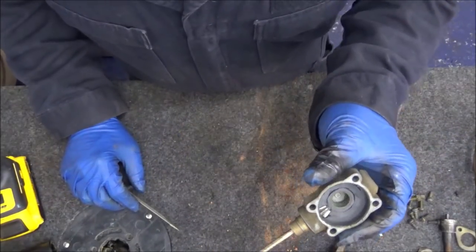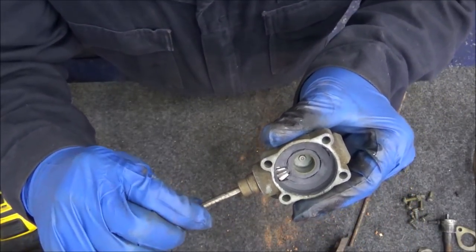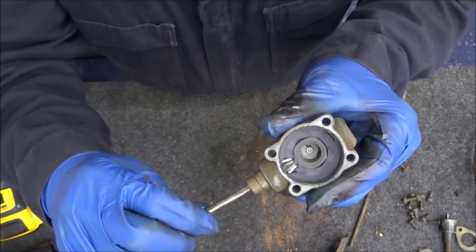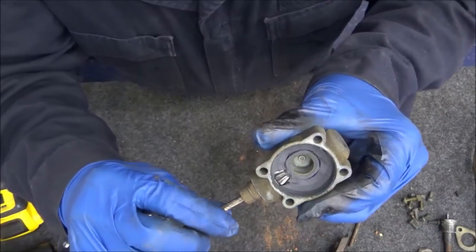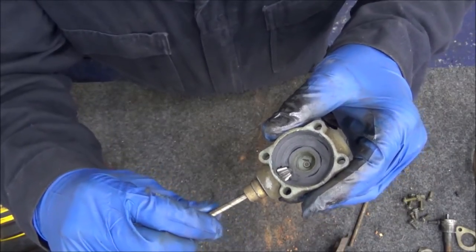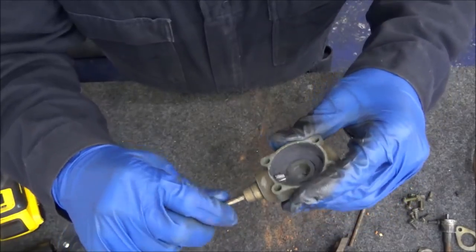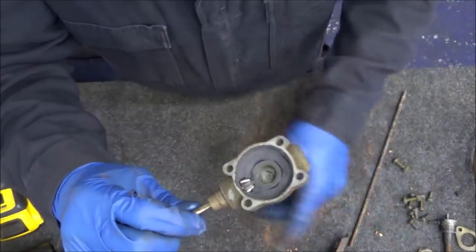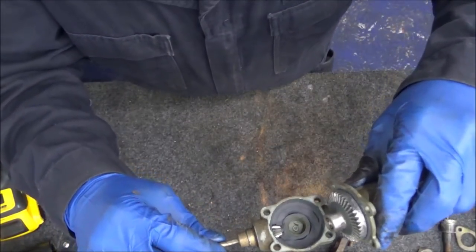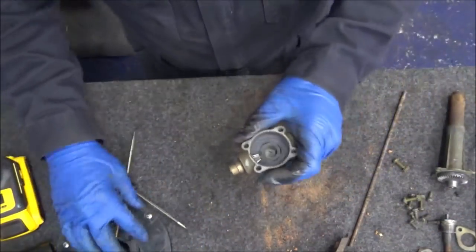This is packed full of grease — great — but you can see the grease isn't doing anything because over the years it's become so packed and hardened and pushed out of the way. Like that Lucas Oil gear demonstration in the parts stores — the grease should be down in there in all the cracks. Where the actual gears are, where metal meets metal, there's not much lubrication at all. That's why we're doing what we're doing.